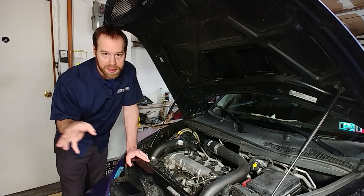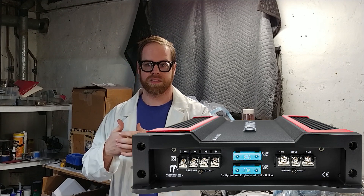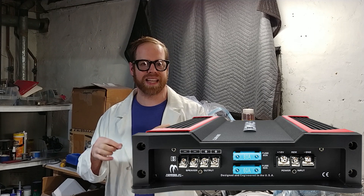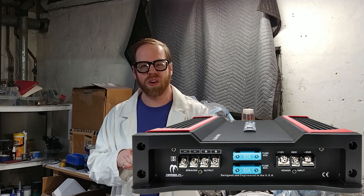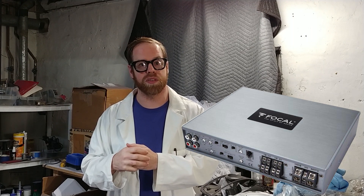Yo, yo dawg, that fuse has to protect your amplifier from damage. Okay, so here's an important myth that we must address. The real purpose of a fuse is to protect the entire circuit that it's connected to. And an amplifier certainly is part of that circuit. However, an amplifier does have its own internal circuitry with many branching pathways. Some lower-end amplifiers do feature some built-in fuses, and what they do is really protect that power supply stage from internal shorts. But higher-end amplifiers have smarter protection — they can sense faults on the output stage as well as the input stage. So they are very well protected.